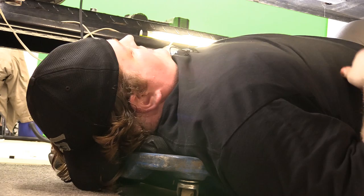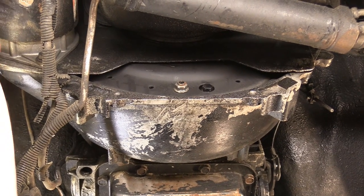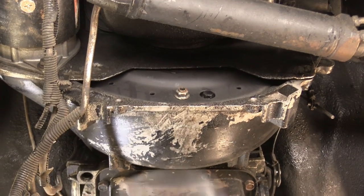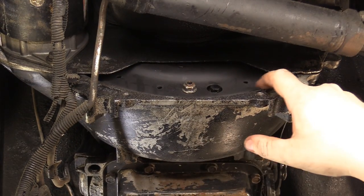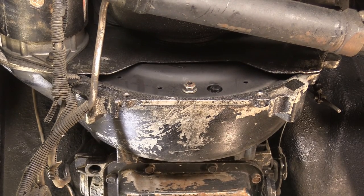For the record, he's supposed to be wearing safety glasses. I've asked him to wear them — he refuses. So we are under the car now. I've got a battery charger hooked up, and before we pull this starter off, we're going to allow it to do some work for us. I've got a remote starter switch here, and we're going to use the starter to bump over the engine to pull our torque converter nuts into place.